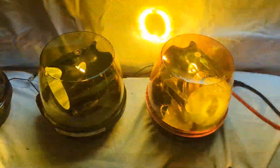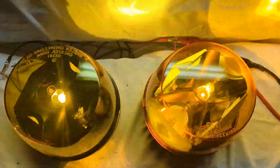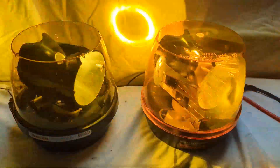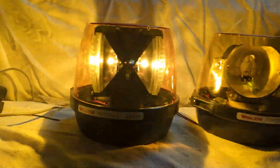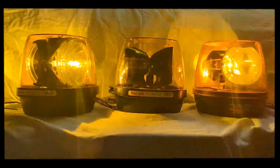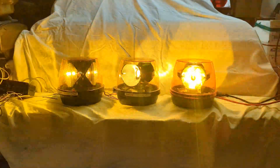There's a lot of discussion about perceived brightness versus actual candle power, lumens, etc., and several different metrics have been set for measuring perceived brightness versus scientific light output over the years. Whelan states their HID produces 125,000 candle power versus 25,000 candle power in the standard halogen. They also note the amp draw is about half — two amps versus four per unit. Bulb life for their HID is listed at 1,500 hours versus 300 hours for their halogen. Color temperature is 5,500 Kelvin for the HID and 3,000 Kelvin for the halogen.